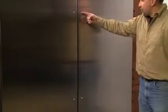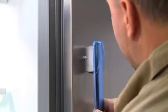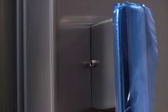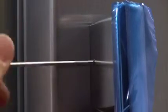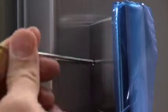On the door, note the position of the upper and lower pre-installed shoulder bolts. Position the handle's end caps over the shoulder bolts. The holes for the set screws face in the direction of the door opening. Hold the handle over the shoulder bolt and firmly press the handle against the door. The set screws are pre-installed into the handles. Use the Allen wrench provided and tighten the screws. Make sure the set screws are tight and sub-flush, seated just below the surface of the end cap. When properly installed, the handles are drawn tight to the door and there are no gaps.